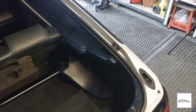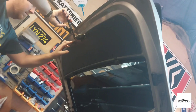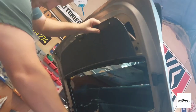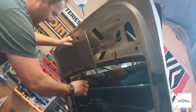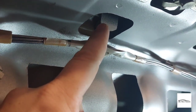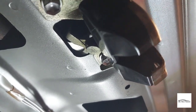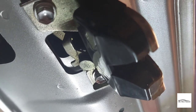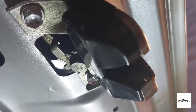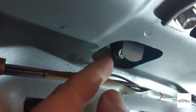Because it seems to be the easiest to get to, I'm going to start with the boot lock. I just need to remove this panel, which is held in with push clips. By the looks of it, all I have to do is pull this clip out and the lock comes straight out. If I use the key to turn, there's just an arm that hits and releases the boot. There are no wires or cables attached, so this one should be really easy to remove.